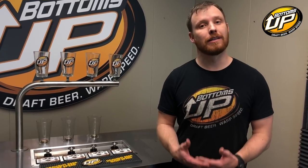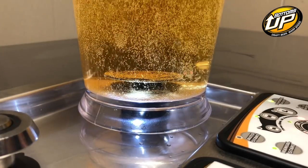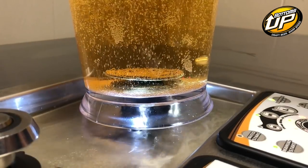The worst is putting a dispenser away without cleaning the lines first. Another rare issue occurs when you're using some of our taller vessels, such as the 32-ounce cups or our pitchers. If the dispenser is too far out of level, as the vessel gets full it will start to tip, causing beer to leak out the bottom as it is filling. To fix this, simply level the dispenser. For our taller vessels, you don't want the drain pan to have more than 2 degrees of pitch.